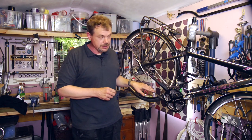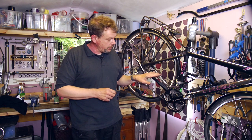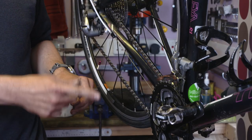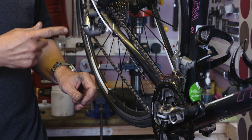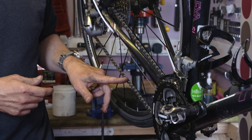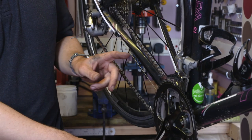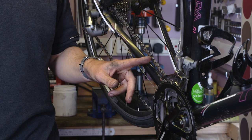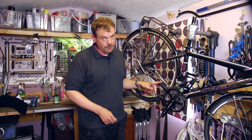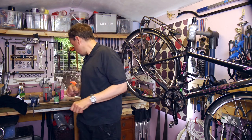This chain has been removed and thoroughly degreased, so there's no lubricant in the chain at all — we now need to add some. We want to run right round the chain once with an application of lubricant, so we need a start and finish point. For that, we'll use the joining link. Most chains will have a joining link fitted, or at least a factory-fitted pin that looks different to the others, which you'll be able to see when the chain is clean. So we start with the joining link.